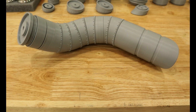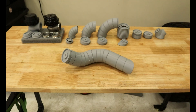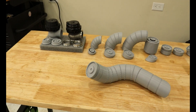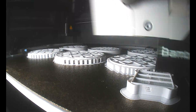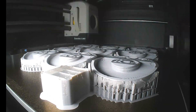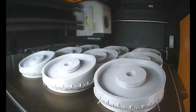I developed tubing building blocks in all readily available tube diameters and bend radii, to also include exhaust bellows. These building blocks replicate the exact exhaust pieces you can buy online — some are slightly altered for better 3D printing. This development took months of trial and error, three major design changes, and hundreds of iterations getting tolerances to work exactly as I intended.